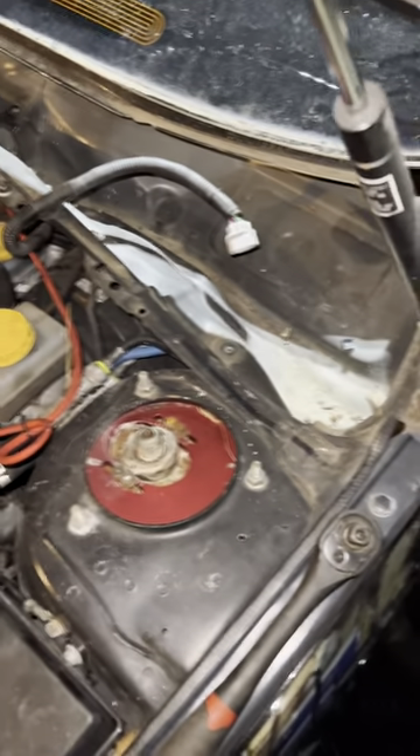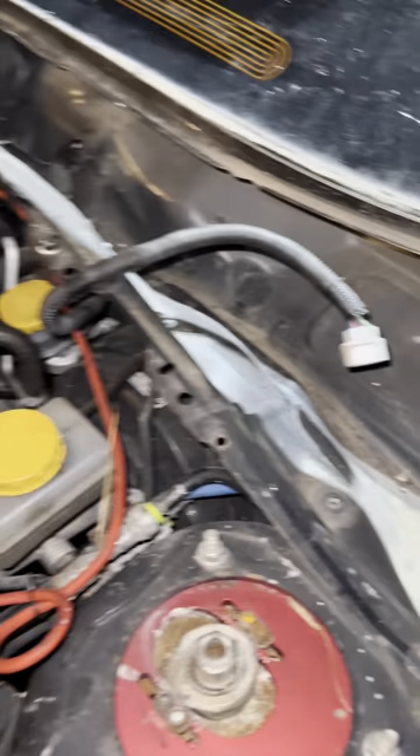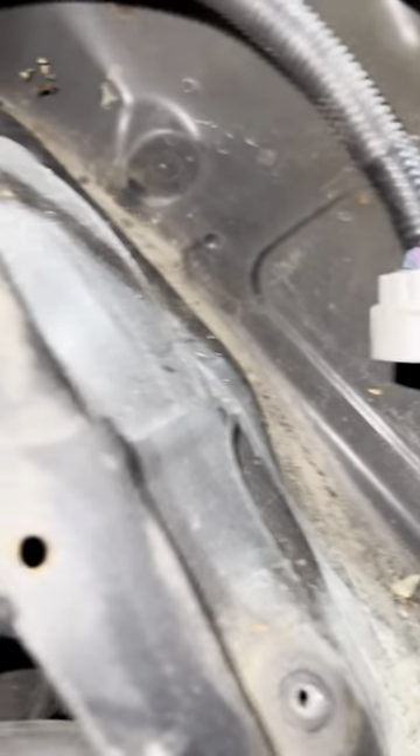As a part of taking out the clutch pedal assembly, you need to remove the cowl. It's just some plastic tabs across the top — these just pop right out. I went ahead and unplugged the windshield washer arms assembly, and then it's just three bolts: one, two, and three. Take the whole assembly out.